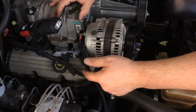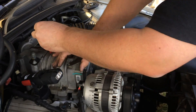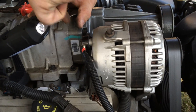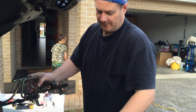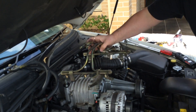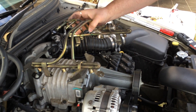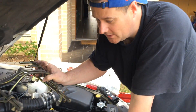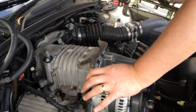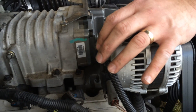This is a makeshift because it burns all the wiring harness. I changed one on the VS once - it took me all day so I'm not going to do that again. I might just get the vacuum and suck some of that muck out of there because that's really dirty. The importance of disconnecting the battery terminals: we've got all this fuel here, and the back end of the alternator - I haven't got the rubber cap back on - so that's exposed, straight to the battery, which is very dangerous.